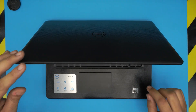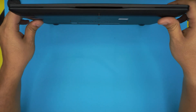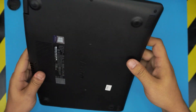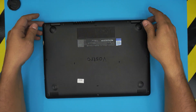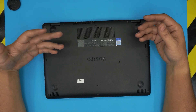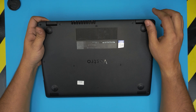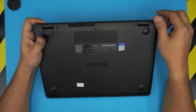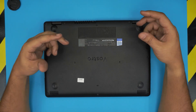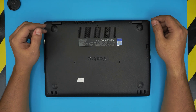These come with an Intel Core i5 10th gen CPU. In this video I'm going to show you how to open it up and how to repaste your CPU on this laptop. If you have a very dirty or really dusty fan they do suck in a lot of dust and get blockage in there, or the thermal paste dries up — you should do a repaste every year or every two years.